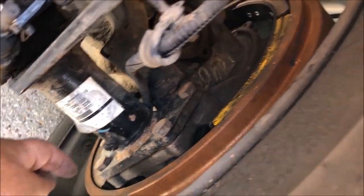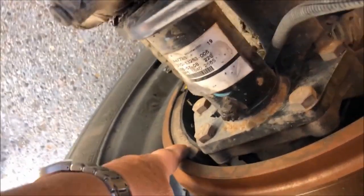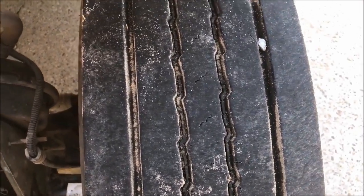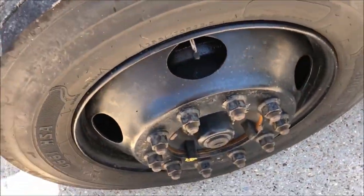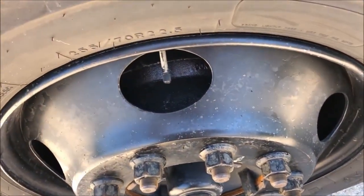Going to the inner tire, we have our brake drum — not cracked or broken, in good condition. And we have our brake lining — no excessive wear, no oil of any sort, and in good condition. Next will be our tire. We are looking for ICD: inflation, condition, and depth. The inflation of the tire must be checked with a commercial air gauge, and your valve stem is straight, not bent or broken, and has a valve cap.